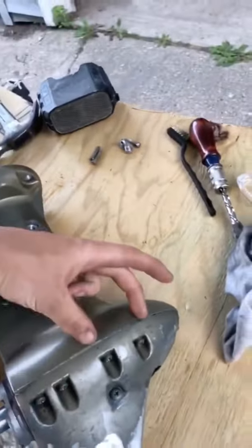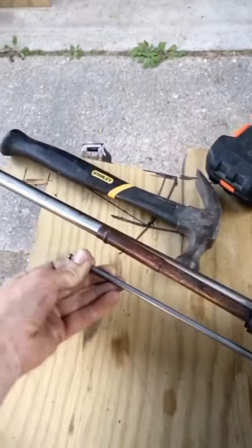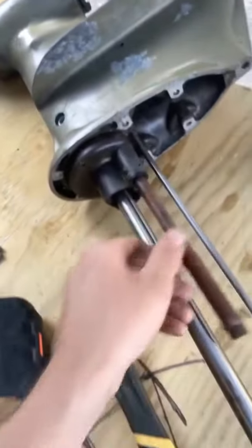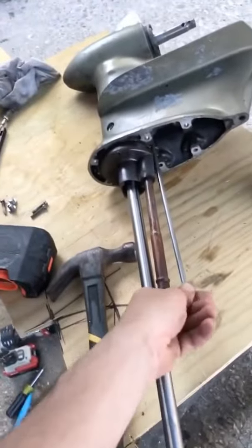Pretty much like a transmission. There's like 2 gears here, and then there's a dog clutch that chooses between them with your shifting rod here. This goes up and down. It's kind of all taken apart right now. And then this is the drive shaft. So when you spin this, it'll spin. Yep, you can see it spins there, depending on where the linkage is.